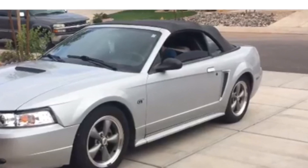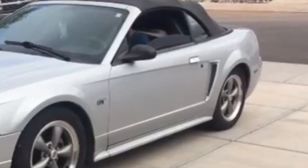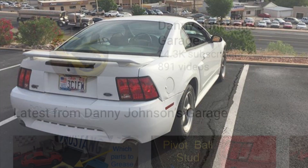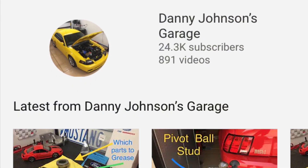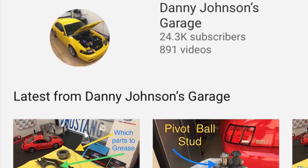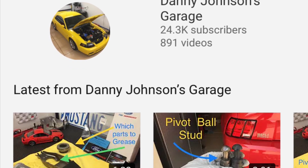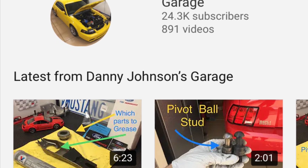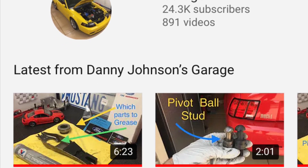Here's a picture of 05-09 Mustang wheels on a 99-04 — you can see how far they suck in because of that positive offset. You would need wheel spacers to bring them out so they look somewhat normal. Here's what it looks like with the correct wheel — it lines up pretty normal looking. Hopefully you enjoyed this video. If you found it useful please give it a thumbs up, and if you're new to the channel please subscribe. We have new content coming out and we're up to about 900 videos.